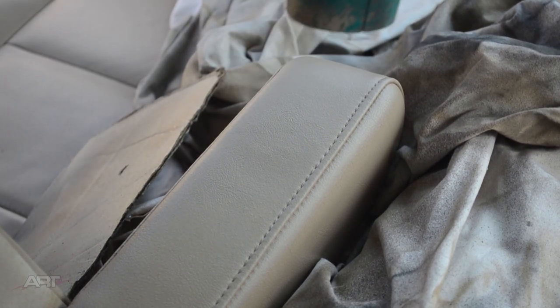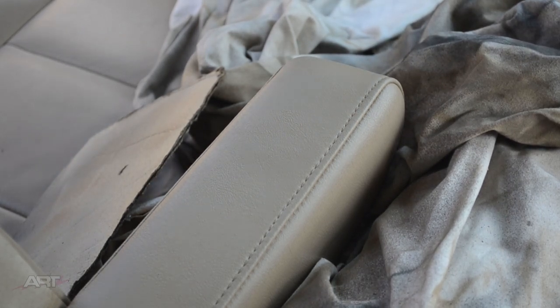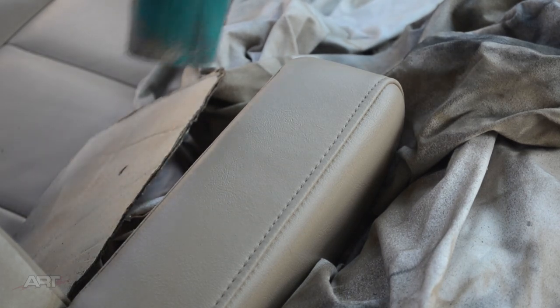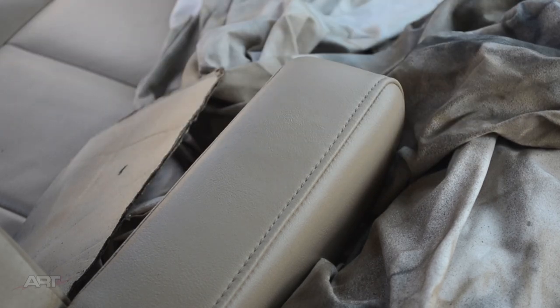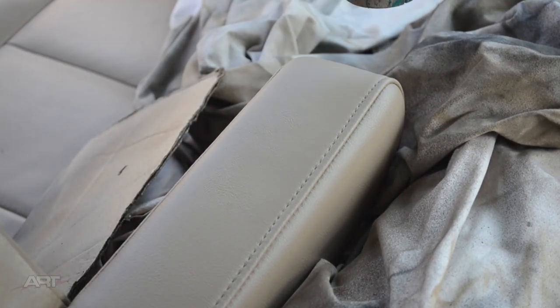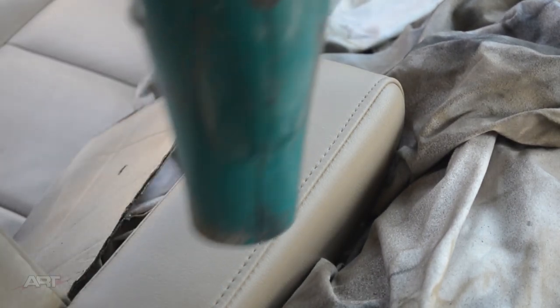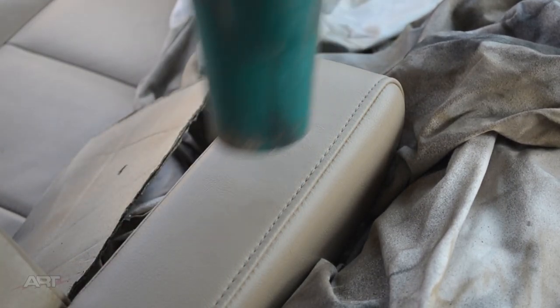Now I'm atomizing better with the gun. This is our final color coat and we're drying it down with the hair dryer. The aim here is to give us our satin look. Folks often ask how to avoid a shiny spot where you've done the repair — well, as you can see, just this proper method right here takes care of that without any trouble.